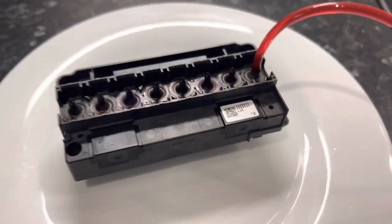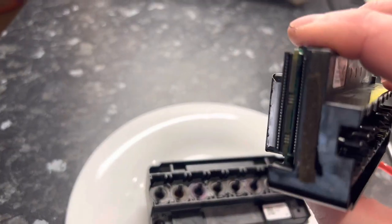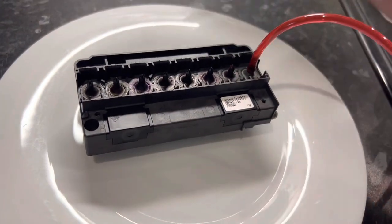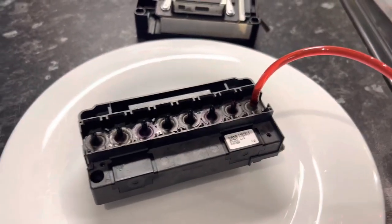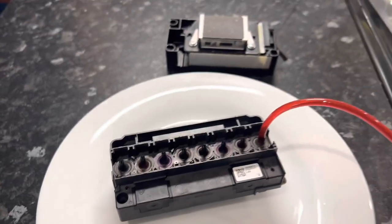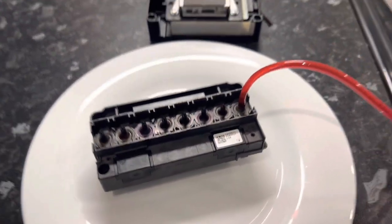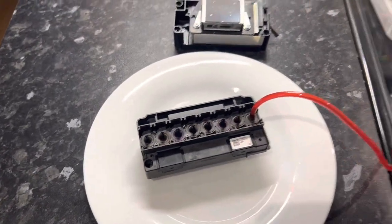Before you put it back in your printer, I'd advise you to spray a bit of contact cleaner on the contacts for the ribbons, just to be 100% sure there's no water residue left behind. Even spray the back of the PCB before you put it back together if you can. Then leave it somewhere to dry and do not refit it for a good 24 hours — longer if possible — because quite a high current is sent to these heads, and if they short out on the board you can burn out the ribbon, burn out the head, and blow the fuses on the main board.